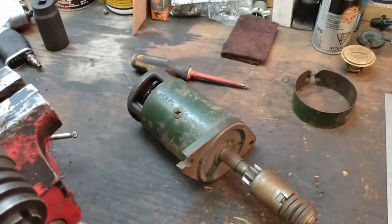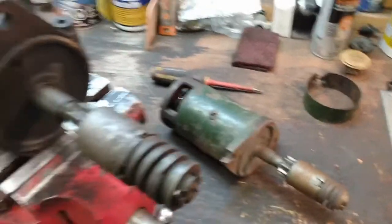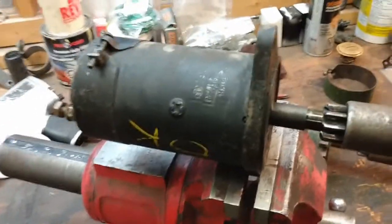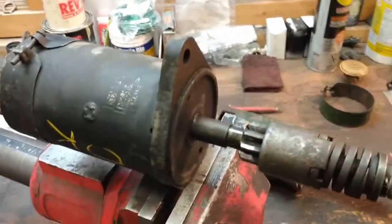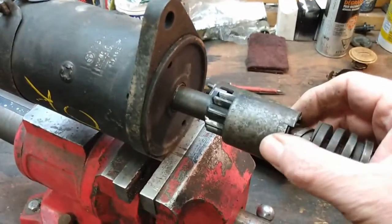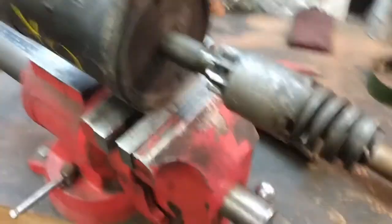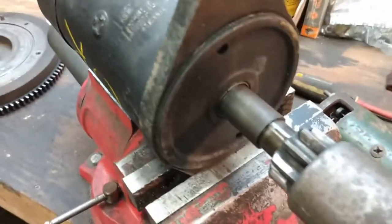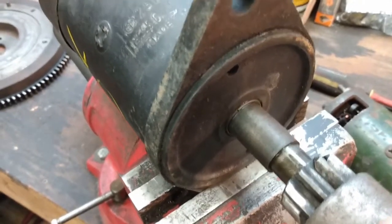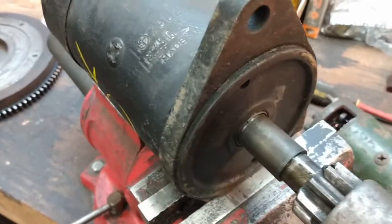When the Bug-Eye arrived in the garage, this green starter was in a box and this black one was on the engine. It says OK on it but we're going to check it out anyway just to make sure. One of the things to check on these is the starter gear itself — the intent is that it returns quickly and smoothly — and that seems to be alright. One thing I am concerned about is the condition of this bushing here. You can see there's quite a bit of play in that, but that's just a matter of replacing the bushing if that's necessary.